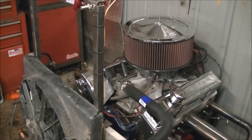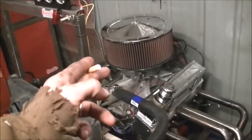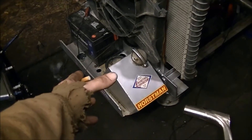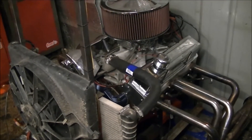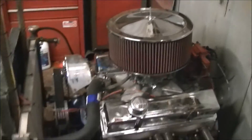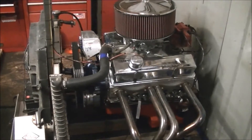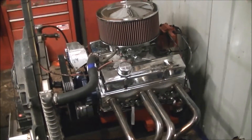The second time I started it, it was trying to start without the ignition switch on. So I hooked a line up to it, turned on the switch, pumped all that fuel out into a tank, and put just 93 in it — that's what it ran off of in that clip. On just 93 it seems to be okay; I don't think I'll need any additives. But 87 is a no-no, even blended with a little 100 low lead.